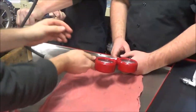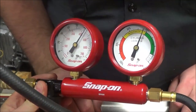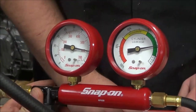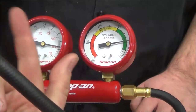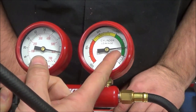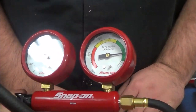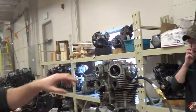Okay, now let's check — we were just pouring out before, leaking like crazy. Look at this — look how much we've improved! That's perfect. I said I felt confident we were going to bring this motor back into a totally serviceable engine. I can't quite get to 100 psi — the air compressor is being consumed somewhere else — but I have about 86 psi and we're at a 20% loss. What did we say is the commonly used maximum allowable leak in the industry? 20%. This is exactly right.